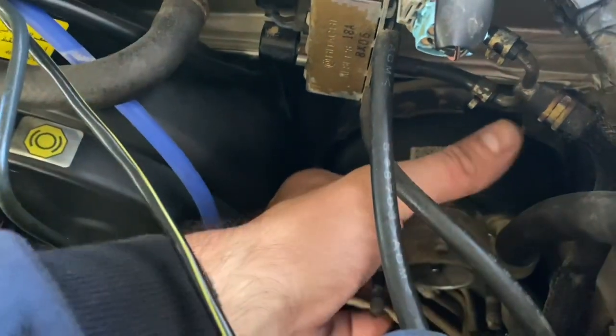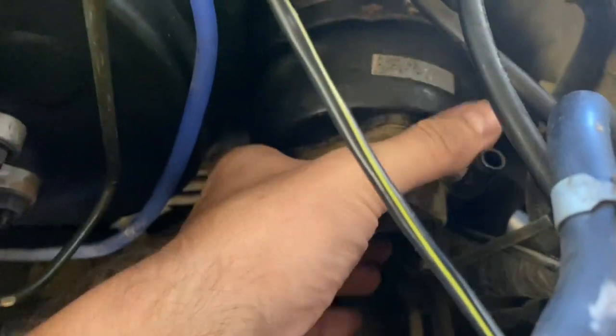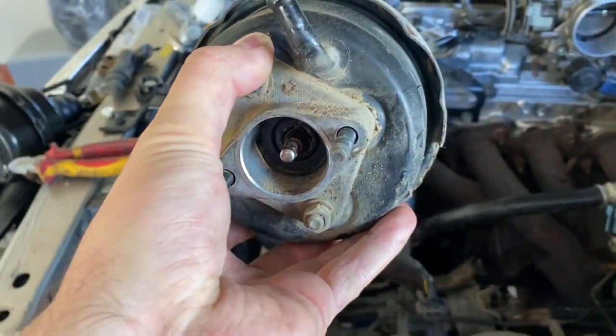So now that we've opened it all up, we should be able to wiggle it free from the front here. There we go. So don't forget to remove the vacuum hose that is also attached to the booster. And now we should be able to just squeeze it out. There we go. That is the old one,